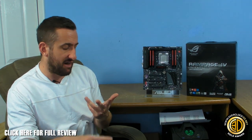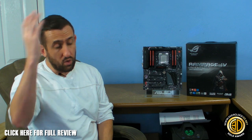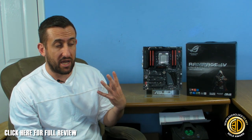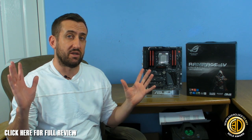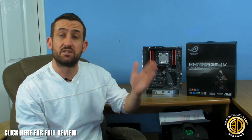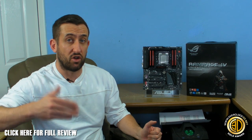I changed the CPU, I changed the memory, I changed the graphics card, I ended up putting a different solid state drive on, fresh install, all to then find out that it was that one thing in the BIOS, which was my own fault, and I don't mind admitting it, because it's all a kind of learning process. I was treating this too much like the old one, rather than going through the stages like I should have done. So it was my own fault, and it just solidifies the fact that I've always said, do your overclocking in stages.